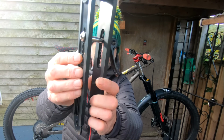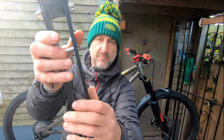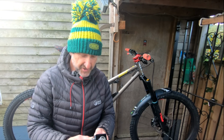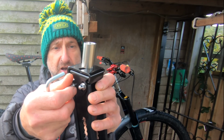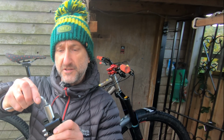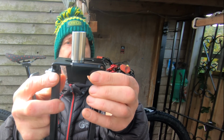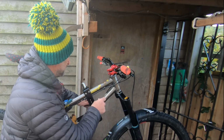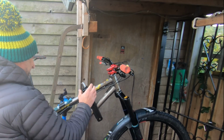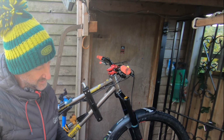This thing is fully enclosed in a rubber sleeve, obviously to protect your frame. Position it 200 to 300mm back from your bars. Right, so I've undone these little side 8mm, and I'm going to undo the 6mm on top, and then we have our width for the width of the frame. Put the adjuster back through into the middle, tighten that up. It's got amazing grip actually. Tighten the cap screw back up in the middle, fitting the axle.